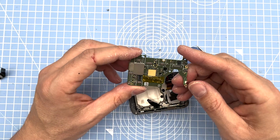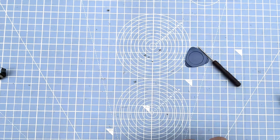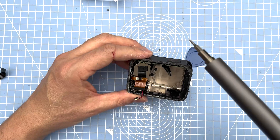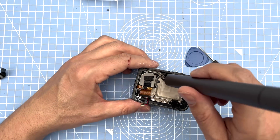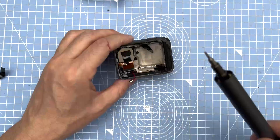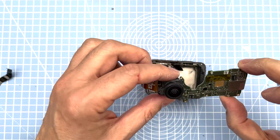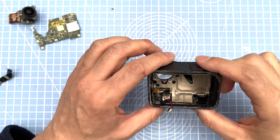We've got the main board popped out, nice and clean — put that aside. Next we're going to get the camera out. There are three screws which hold it down, clearly visible on the corners of where it's connected. It should come out relatively easily. So we've got two of the main pieces — now we need to get the screen out.